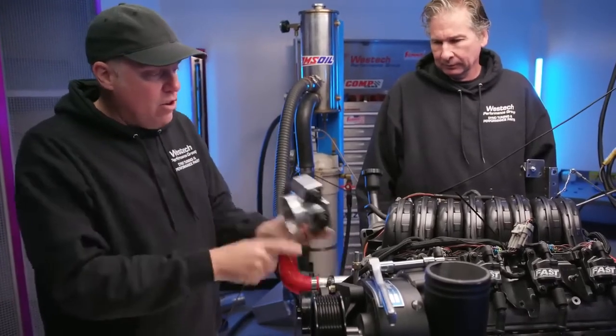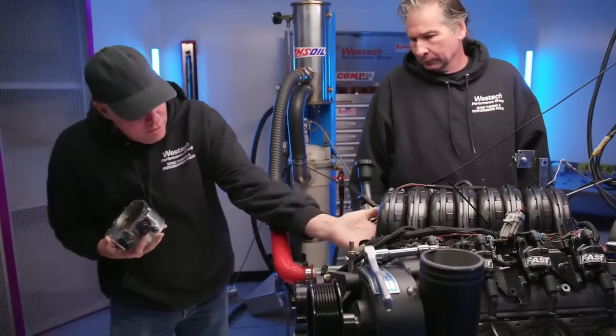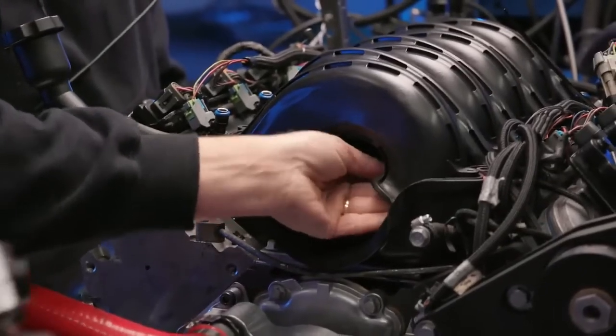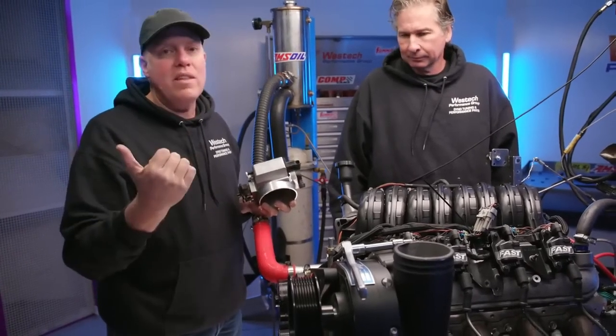And you can see air goes in here and the water and meth pretty much is shooting all the way to the back. See, the cylinders pick up the runners like right over here. This is very similar to what's inside that other LS6 Dorman intake that we're using on that other engine. Just thought I'd give you a quick visual on a different engine as to why this thing is a disaster.